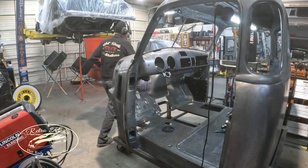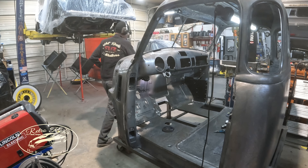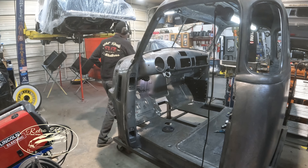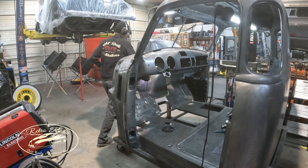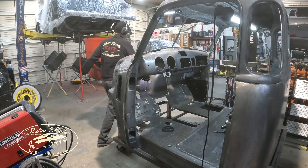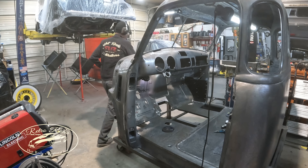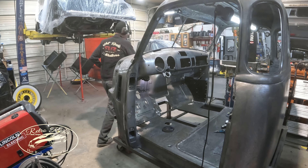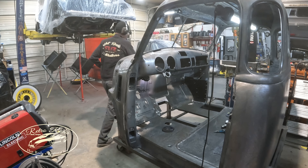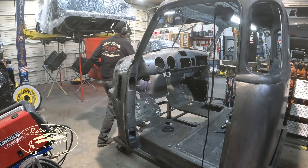I've got that one out already — it's already zinc welded and cleaned up. But this one here, I had to come up quite a bit higher; it was pretty bad up in there. At least the inner structure looks like it's pretty decent. All of these spot welds go all the way up this thing — they didn't spare the spot welds on there, that's for sure. But the new panel doesn't have this one, which is fine — I don't need that. I think it comes up to about here and I'll just put it straight across.